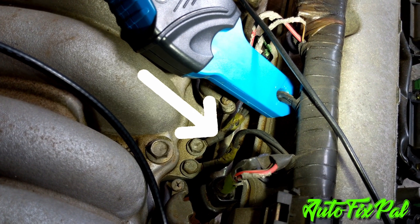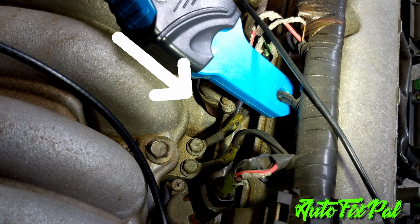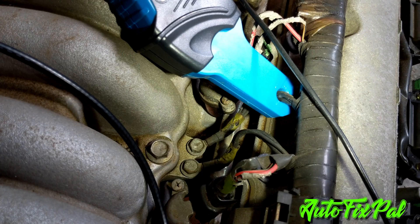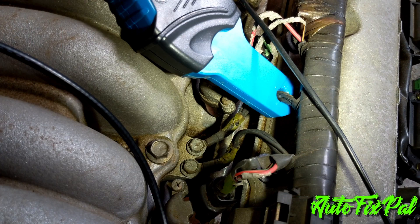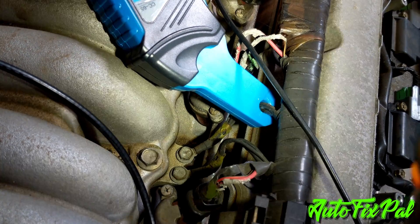To figure out which one of those two ground wires is the ground wire for the ignition coils, you simply hook up your amp clamp, look at the pattern on the screen — it should look like this or this, one of the two. One of them will be flawed, one of them will not be flawed, depending on what's wrong with your car. If nothing is wrong, you should have a perfect pattern like this. If that doesn't work, hook it up to the other ground wire and figure out which is which just by looking at the pattern.